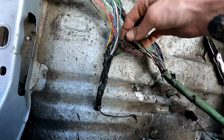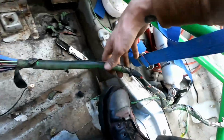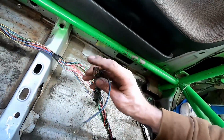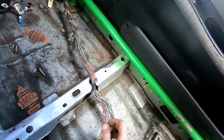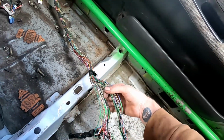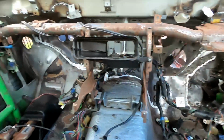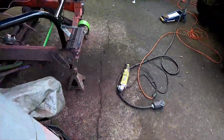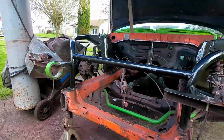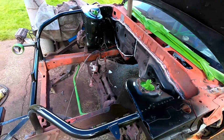Besides this ground, which I can see goes to multiple grounds, so there's a solder joint in here where it's a bundle. I'm thinking this just turned into a whole bigger job, because normally I would tape that over and you wouldn't see it, but I'm trying to get this a little nicer, and if none of this is required and all I need is this, we're gonna go through and delete all of this, which is all pop-up stuff I'm guessing, and get rid of all of it, and we're going to do what I'm assuming would be a typical old-fashioned 240 fuse box relocation. Get the 240's harness laid out up front, I guess. Everything's looking all nice with the carbon mist, so we'll start routing the harness out here, I'm assuming.